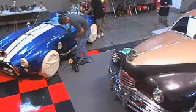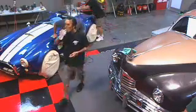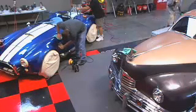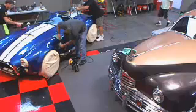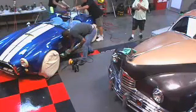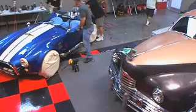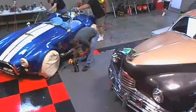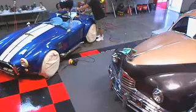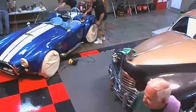Hey, do me a favor, set this over there by that wax. It's right there in the corner, there you go. Yeah, much slower speed. Because you need the high speed to remove small particles of paint, but when you're putting the wax on, you're not trying to remove paint anymore. So you're just trying to spread out a nice, thin, even coat.